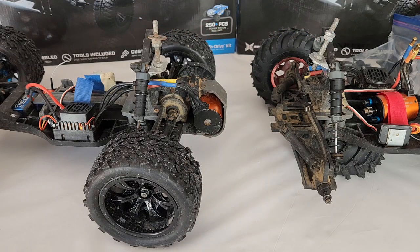The one on the right side has no motor, motor mount, or transmission mount at all, and the one on the left is the fully complete unit. They were all recently run in the snow, and during that run we noticed the one on the right side with the red rims was making some really bad clicking noises. We thought it was just the spur gear, because we've had issues where the spur gear goes bad and breaks a tooth — but it turns out that wasn't the issue, and we'll get into that in detail in a minute.